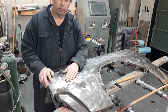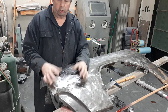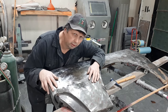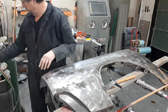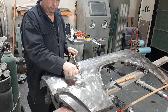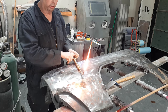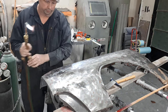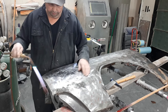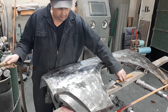By feeling it, it probably needs a couple. When you're shrinking something, you go for your highest point and decide - if it's a small peak, use a little tiny shrink. If you've got a great big hump, you want a larger shrink but maybe not as bright or red a shrink. You heat it up in a circular motion, you'll see it get red - you don't want it to get too red - then you take your hammer.